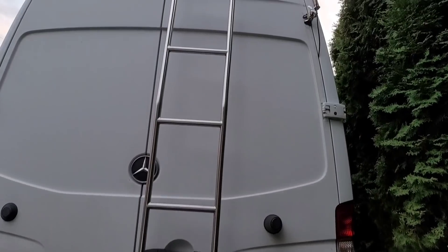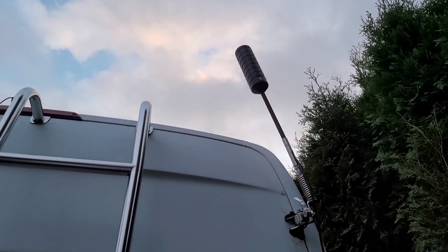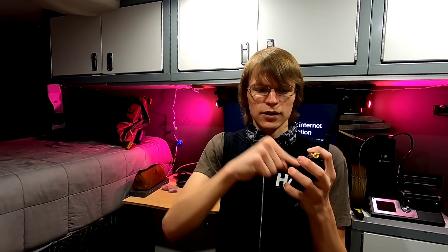So what can we do to improve our signal strength and get rid of the Faraday cage issue and multipathing of using a modem or cellular device in the van? Well, we've got two options: we can just use the booster, which I don't want to do, or we could use an external antenna. The cool thing about the booster antenna is it's obviously the correct frequency for the LTE modem — it's designed for cell phones, after all. We just need to connect that antenna to the modem.